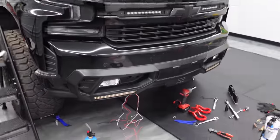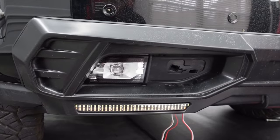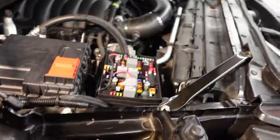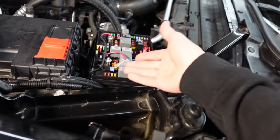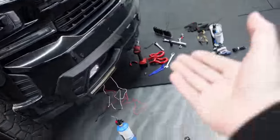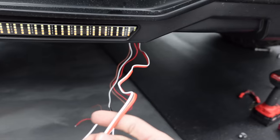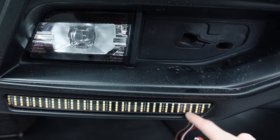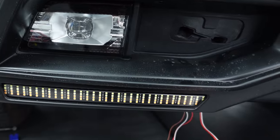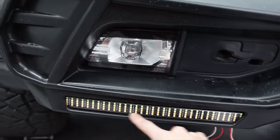We've taken a little bit of time thinking through how we're going to be wiring our LEDs in. I decided I did not want to cut and splice directly into the backside of that fog lamp. Instead, I'm going to use a simple fuse tap here at the fuse box — the fuse we're tapping into controls the fog lamps. This way, if I remove it one day, I can simply pop the fuse back in with no traces of modification. On each of these aftermarket LEDs there are three wires: white, brown, and red. The white goes to ground, the brown controls the amber LEDs, and the red is power to the white LEDs. We're going to run the red wire up to the fuse tap, the white wire to a ground on the frame, and cap off the brown — we're only using the white LEDs.